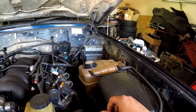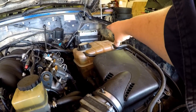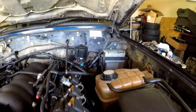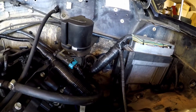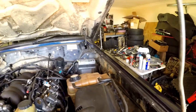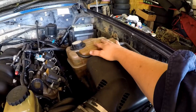Eventually it will get a snorkel — I've actually purchased it, and it's going to be through the bonnet. Hopefully it can clear, because it's going to come in that side where the ECU is. I can't actually move this guy to the left anymore because there's two aircon pipes that are duct-taped off right now coming out of the firewall. So hopefully we can get it to fit. He might have to be moved to the front, and then an airbox put back where he is.